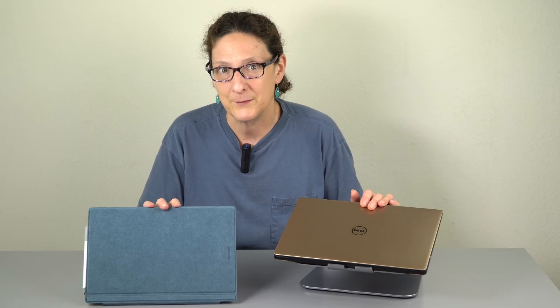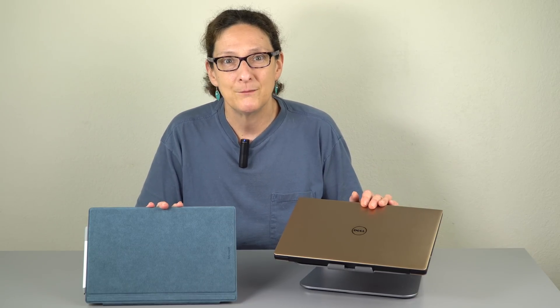Moving from a Core i5 to a Core i7 gets you 5% to 7% performance increase with these dual cores. The most interesting option will be that 28-watt chip with the Intel Iris 650 graphics, but that one's just not that easy to find in laptops. If you're really looking for that punch, it's still going to be beaten by even low-end dedicated graphics. I'm Lisa from Mobile Tech Review — be sure to subscribe to our YouTube channel for more cool tech videos, and thumbs up if you liked this video.